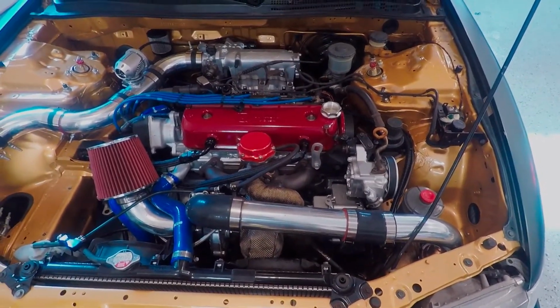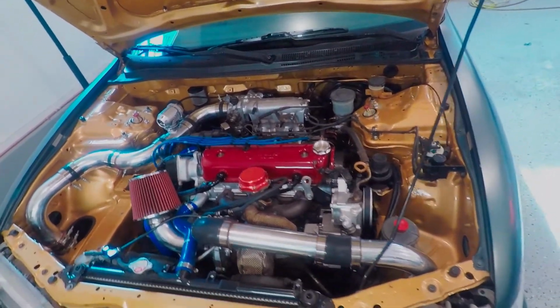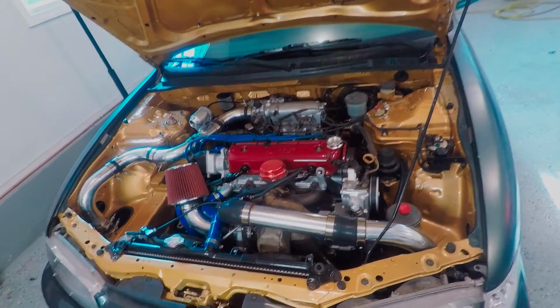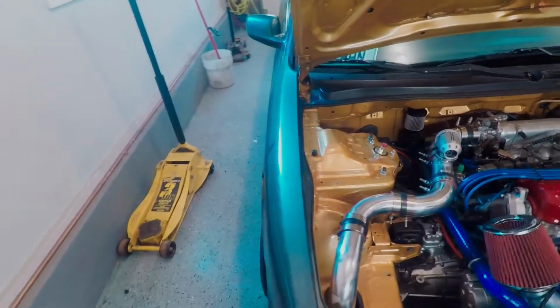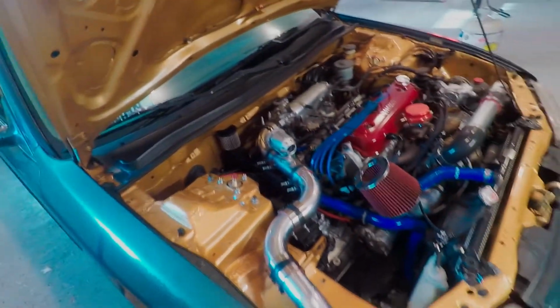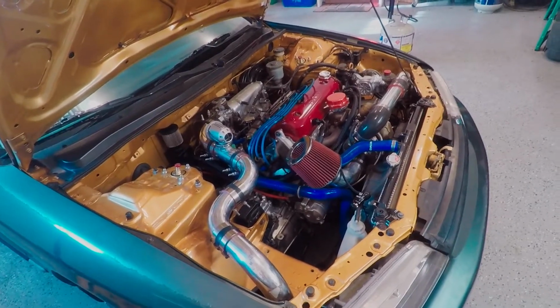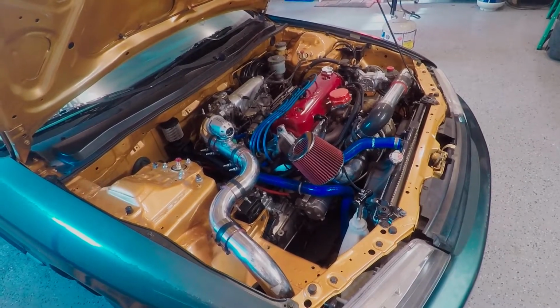And I think that's why I have the low oil pressure, because I kind of have it compensated now to idle at like 1,000 RPMs, and when it idles at 1,000 RPMs, the oil pressure is like 20 psi. It's great, but obviously, you know, we have a bit of a high idle. But I think the pressure's low because it's stumbling, and I'd like to fix the stumble too, because it doesn't sound good. Like the car doesn't sound like it's running good, so I gotta figure out what that stumbling is.